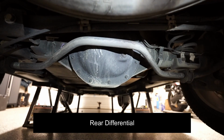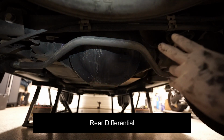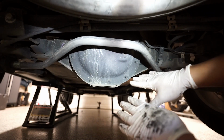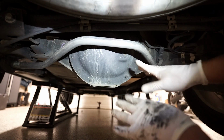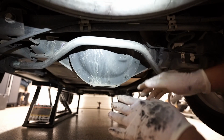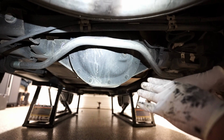Let's go ahead and move to the rear differential fluid change. Okay, so the rear differential fluid, it's a clamshell, and there was actually no drain port. Normally, if I have more time, I actually remove this entire shell right here, take it out, use napkins, and clean the inside of the metal shavings. But in this case,